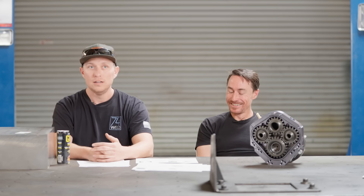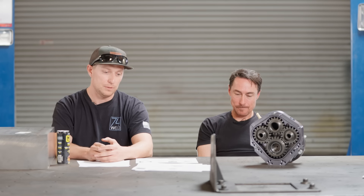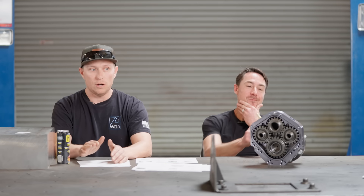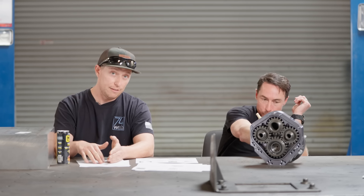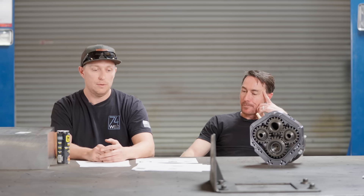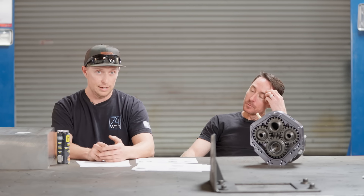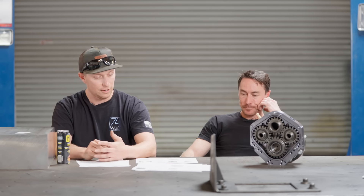As an example, I was working on a setup where I was looking at track bar position and was either going to get more bump steer from dive or squat. We ended up choosing less bump steer in dive so that as you brake it's not going to wander on you. But then when people put V8s in the vehicle and started squatting the thing out, every time they stepped on the gas it wanted to wander — you're kind of threading that needle.